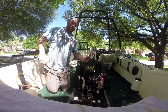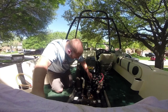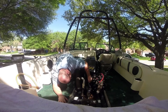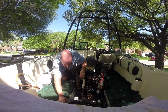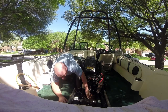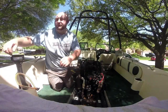To take measurements, we're going to use this — I got it for five bucks from Harbor Freight, it's just a basic magnetic angle finder. First thing we're going to do is put it on this rib of the transmission and find out what the transmission angle is in relation to flat ground. I would say 19 degrees. The drive shaft we measured down here against this nut — the drive shaft is sitting at 11 degrees. So write that down. That looks like about 11 degrees as well.